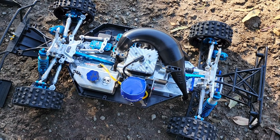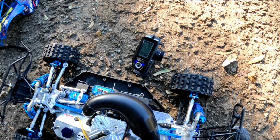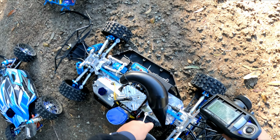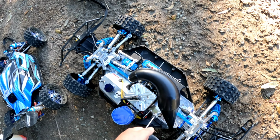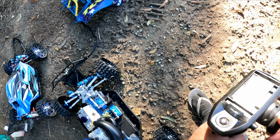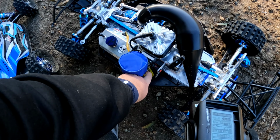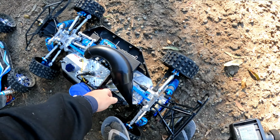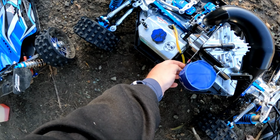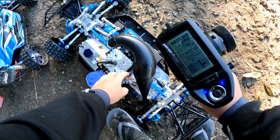All right, I was expecting that. Let's start it back up again. And this time we'll give it a bit of a rev. Okay, not getting nothing. Put the choke back on till you hear a pop. That's what you want to hear. Give it a bit of a throttle, just a little bit.